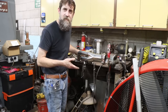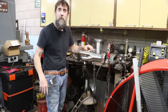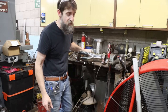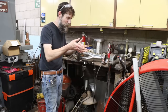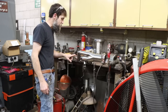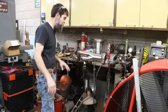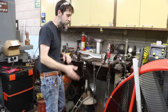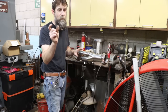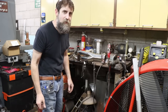These said that they'd fit a C10 in the description, and I just assumed that the C10 and the C30 are close enough, well, they'll work. Well, guess what? These don't fit a C30 with a LS in it. Not even close on the driver's side. What I decided to do was beat the daylights out of this tube because I thought that's where it was hitting, and come to find out it was also hitting down here at the collector. So I got this big booger here on this header, and I would have had to remove at least an inch and a half of web on the bottom of the frame rail so this collector wouldn't hit it, and I wasn't gonna do that.